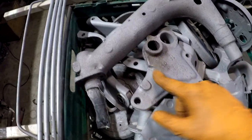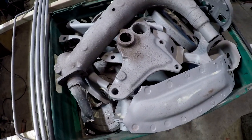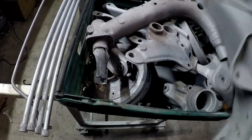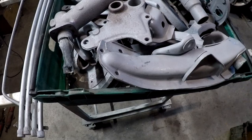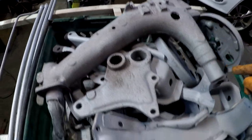I have my suspension bits blasted. Only problem is that between the time they got blasted and I was called and collected them, they already started to rust a bit. Not a big deal, they still have to be cleaned out with the wire brush or something like that before I paint them, so this surface rust would come off, hopefully.